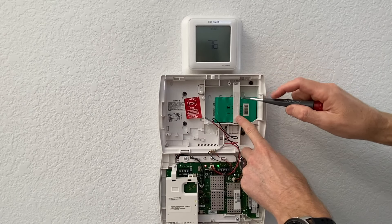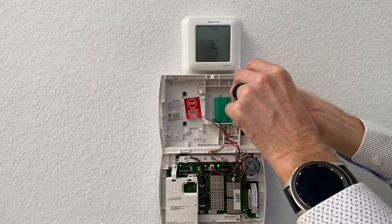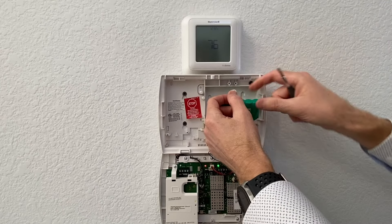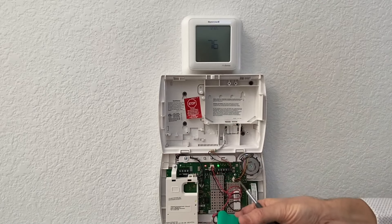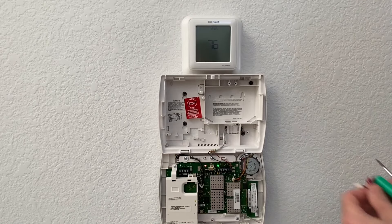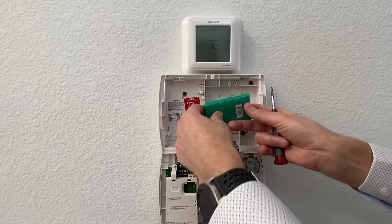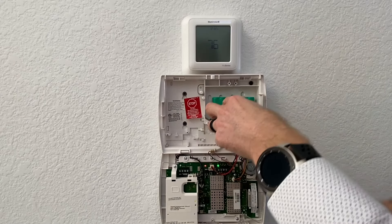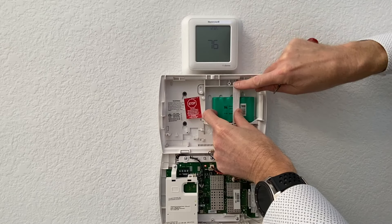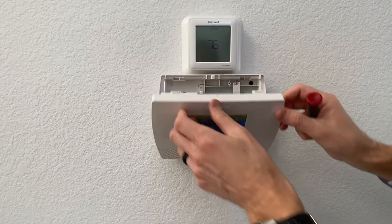You can see the battery pack located here. There's a safety strap that holds it in place — use a screwdriver to remove the screw holding that strap so you can pull the battery pack out. You'll see the wires connect to a small connector that you can unplug easily just by pulling on it. That frees the battery so you can set it aside, get your new battery, and plug it in — the plug only fits one way, ensuring proper polarity of red and black.